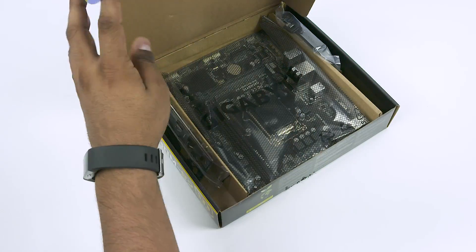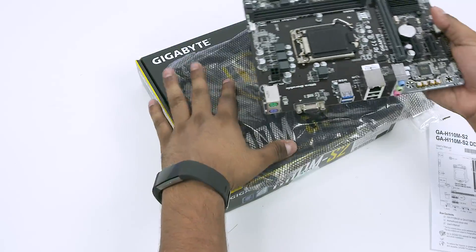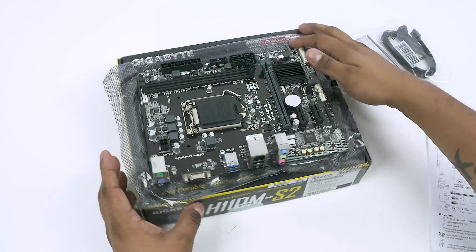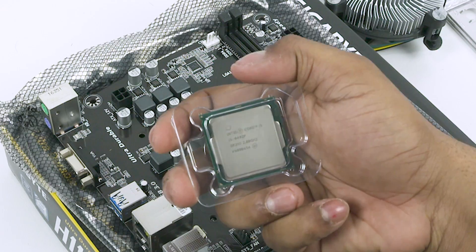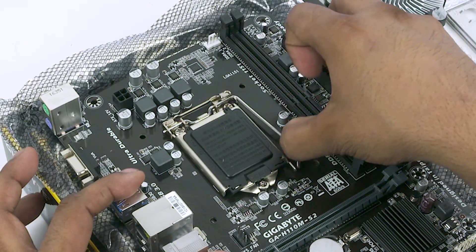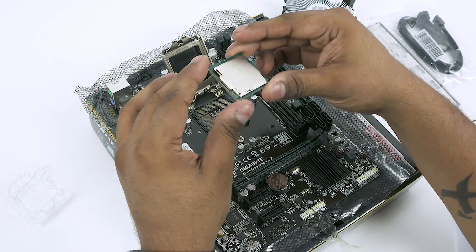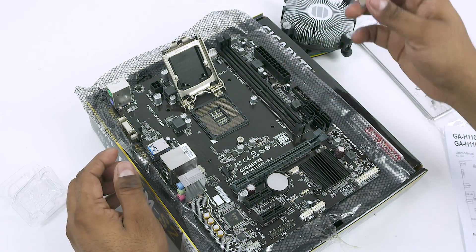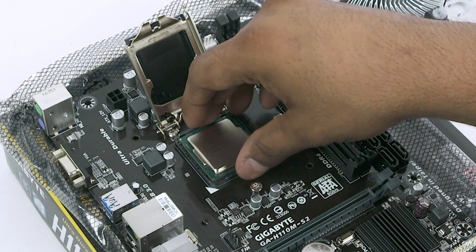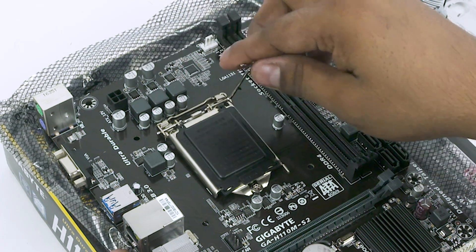Let's now jump to the motherboard and the processor. Take the motherboard out of its box and set it on top of the box — or on top of the anti-static cover; there are arguments for both, let's not get into it. Next, take the processor and the stock cooler out of the box. Look at the CPU socket on the motherboard and release the small lever to the side. Align the triangle on the CPU with the triangle on the lower left of the slot and place the CPU on top. Make sure the notches align — just place it, don't apply any pressure. Now lower the lid and pop the lever back into place to lock the CPU.